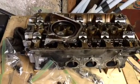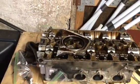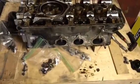Later — probably next week or later this week — we're going to be taking the head to the machine shop. First I'm going to disassemble it: take out the rockers and the rocker rod, take the valves and springs out, the valve stem seals, and everything that they could possibly lose. I'm going to take everything out so I can keep it here and just send the bare head to the machine shop to get cleaned and hot tanked. Depending on the surface of the head — because I haven't even looked at it yet, just the head gasket — maybe take a couple thou off the head just to clean it up. But I think it may not need that. As soon as I get the head gasket off and start tearing that apart, I'll know for sure. But it's definitely getting hot tanked and ready for the process.